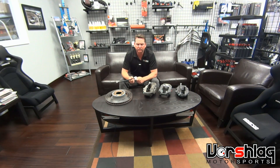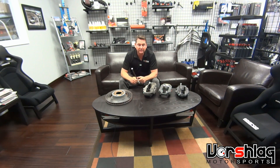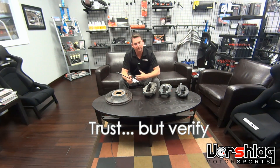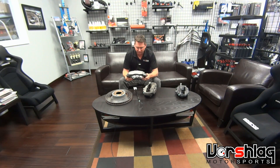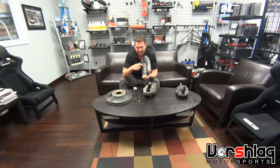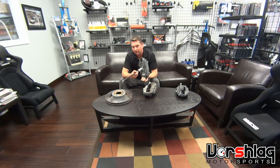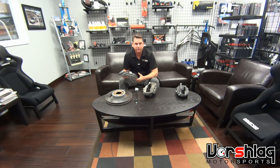Sure enough, when I talked to the Power Brake guys, they confirmed the hydraulics are all wrong — wrong master cylinder for that caliper setup. So that's ordered and will be here this week. We'll do another track test this weekend at ECR to verify that you do in fact have to change the master. We're also changing the booster — it's a different part number and a different throw for the performance pack S550. The Power Brake engineers were following what we discussed on social media and said they can change the piston sizes inside the caliper to work with a different bore diameter of the master cylinder — so they can match it to either the 14-inch or 15-inch factory S550 brake master. We're going with the 15-inch setup for one more OEM test before jumping to the Power Brake kit. Chris, we should have listened to you — you were right about the master cylinder and booster. Those parts are coming and weren't expensive.